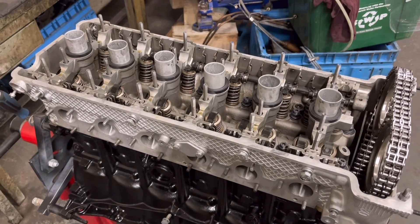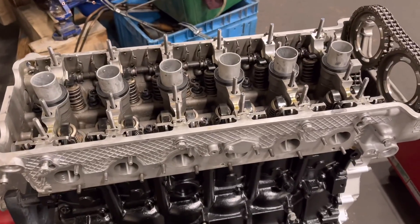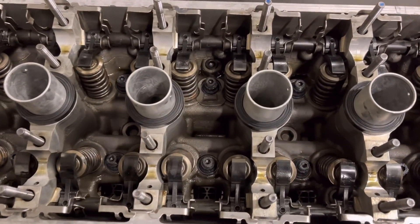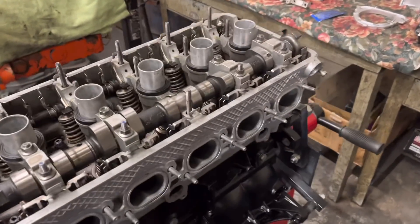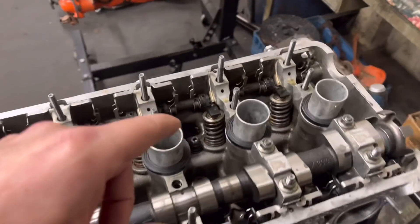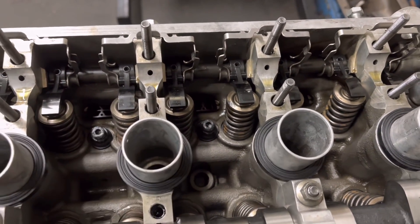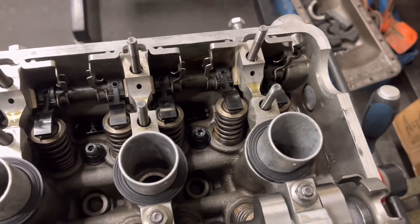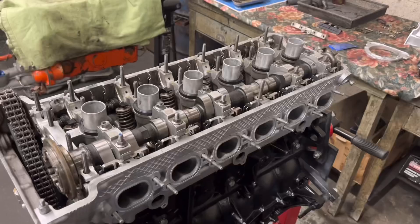That's made me puff a little bit. I just pulled down the two 90-90s and that's all torqued down now. We've got the timing cover on with the chains in there. We've put the cylinder head on, and instead of the original head bolts we have a stud and nut kit — ARP stud and nut kit — which is slightly better than the original bolts.